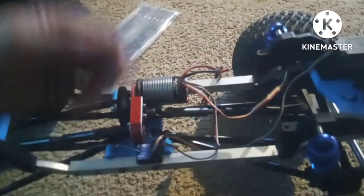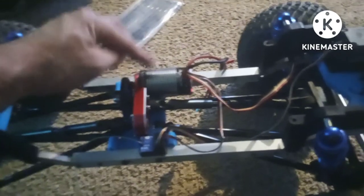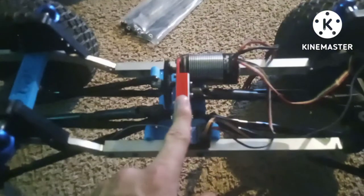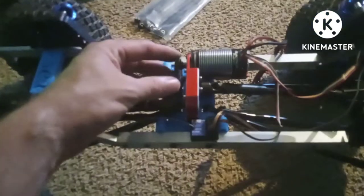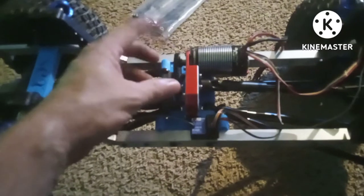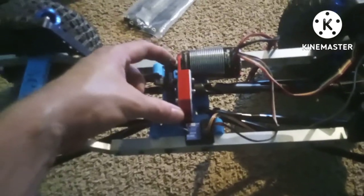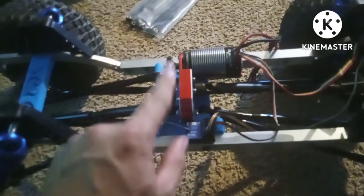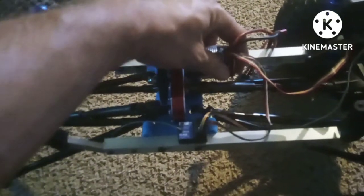I did test it — you're going to see a little run over a tree stump in this video. This motor is the Fusion 1800 KV. This is a TGH2 low comp transmission with 30% overdrive automatically in it for the front. It's a 64-toothed spur with an 11-toothed pinion. That's the smallest pinion I have. I need to drop down to a 9 pinion and probably up this spur because this motor is getting hot — too hot.